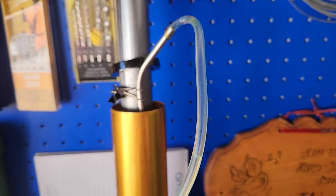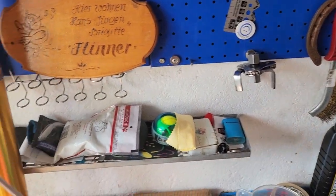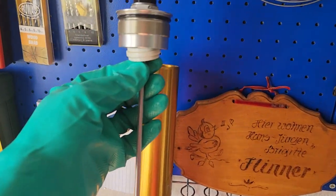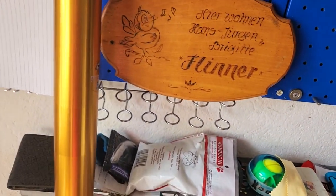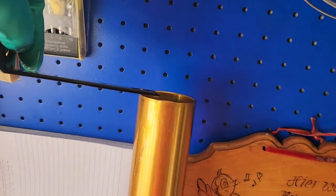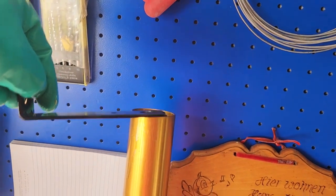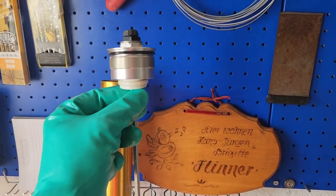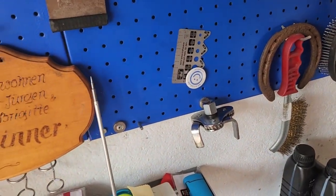Ladies and gentlemen, you are time traveling — I've done the first leg and found an easier way to do all of this. When you open it, put your tool underneath the bottom nut and loosen it — that's just the pinch nut. Once you've done that, twist the top off and slowly extract the needle, or the long rod, whatever you want to call it.